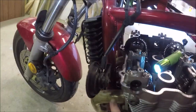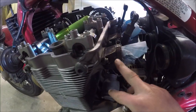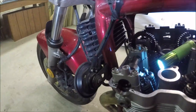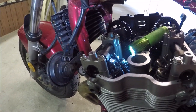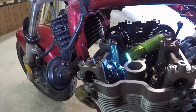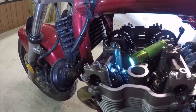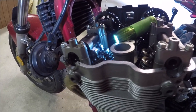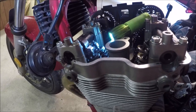This is our exhaust side — the side with the exhaust here. And this is the intake side. These have different clearances based on the side. The exhaust has a bigger spacing than the intake because these parts are going to get warmer. As materials get warmer they generally expand, at least the materials we're worried about.